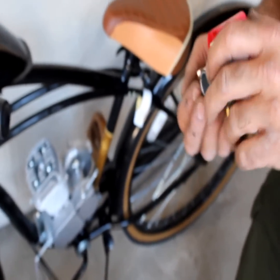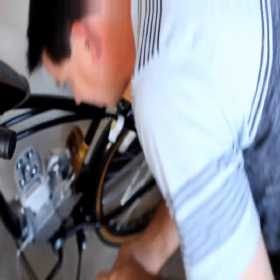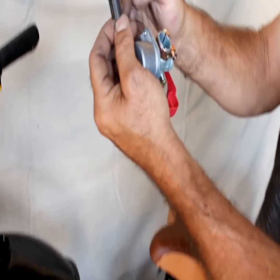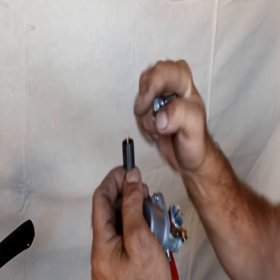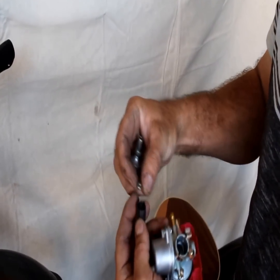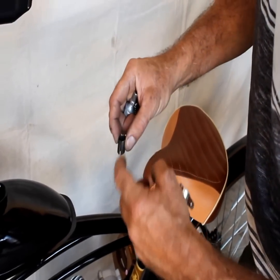You can take all of this out. Sometimes those barrels get sticky. Be careful not to lose any of the innards. What you've got is the carburetor barrel with the needle. You can adjust this — there are five settings. Keep with the main one on the stock kit. Put the slot in so the slot in the washer lines up with the slot in the barrel.